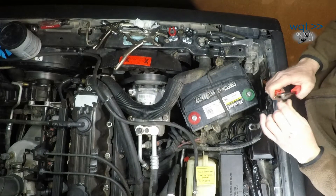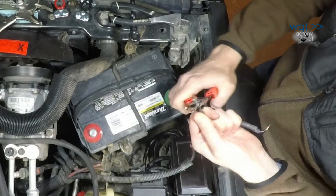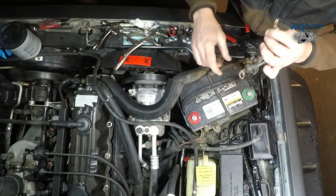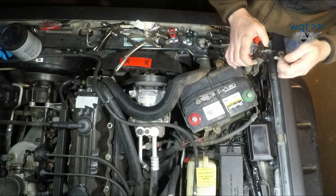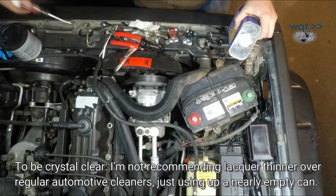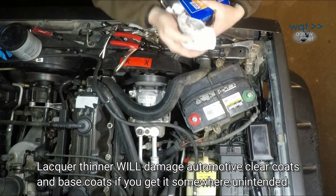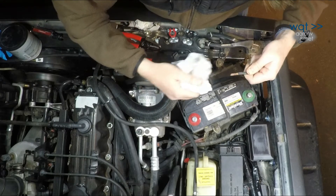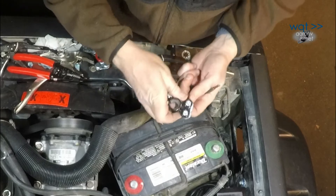Now I've got to strip these wires. I don't have an eight-gauge stripper, so I'm just going to use the largest one on here and gently go in a circle around the wire until I see the insulation pulling loose. Notice I'm still not even at clean wire yet — there's a fair bit of corrosion back in there. I don't want to keep shortening this too much because I don't have a lot of spare lead to play with. Let me try going just a little bit further back. Okay, that's looking better. I'm going to take out the lacquer thinner again and see if I can knock any of that corrosion off.